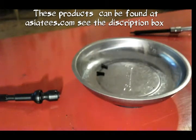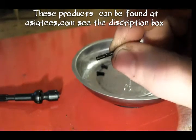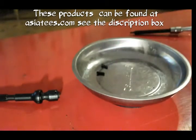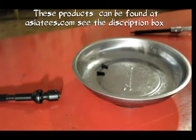So, yeah, we get that in. Line up the pit. In fact, it'll probably be better showing you that as well. See if you can see that properly now. See the divot in the centre, that's what you need to line up with the set screw. So, you stick that in. And once you've put that in, which can be a bit fiddly, if I'm honest, but it's worth doing all day long.